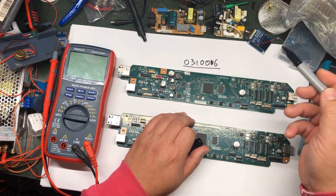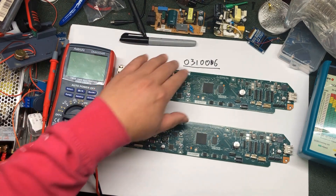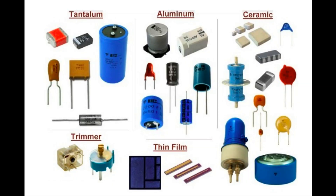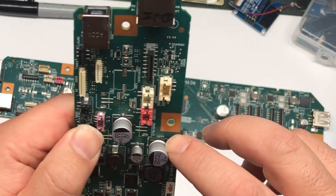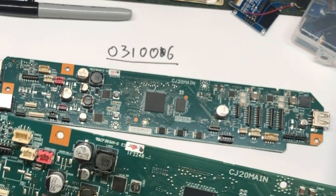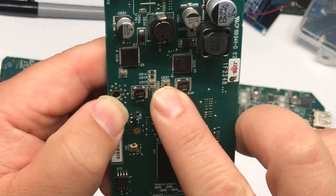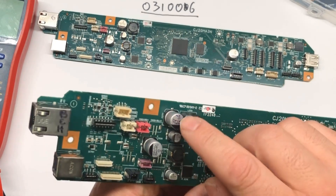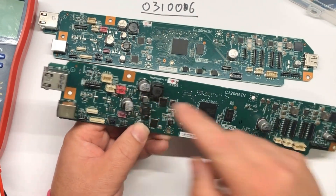Most of those errors occur because you get blown out F1 and F2 fuses, but today I'm going to cover the case where fuses are good but you still have this error. Traditionally when you test a capacitor, there are many kinds. What's great about Epson is they mark every capacitor with a C — like C20770. These big ones that look like water towers are capacitors. See C521 — those are ceramic capacitors. Ceramic capacitors mostly don't go bad over time, but those big water towers do go bad over time, so you need to test the health of those big ones.